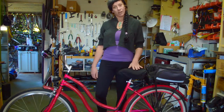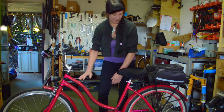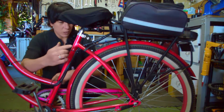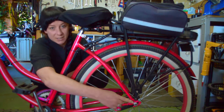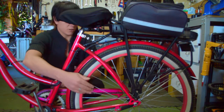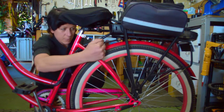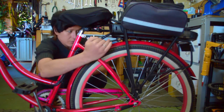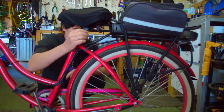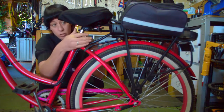This is obviously a different type of bike entirely. The curvy frame means we're not going to be able to fit a battery anywhere in the frame, hence it's been mounted with a rack battery. Fitting a rack battery, you obviously need the mounting points on the frame up near the seat post and down here. Most bikes have these — the idea is you move the struts up and down to get the correct height, and these bars can move through here to get the right level. This is sitting a little bit down at the back so that we could get the seat post all the way down for our demo bike.